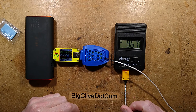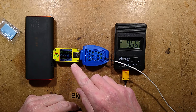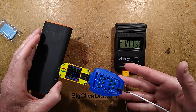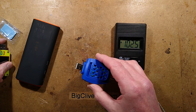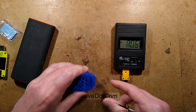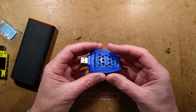That's stabilized. It's just short of 100 degrees Celsius, which is around about 200 degrees Fahrenheit. The current has stabilized at around 700 milliamps, and that's with it hanging over the edge of the table. Now it's time to take it to bits. Incidentally, there is visible vapour coming off it, so these little tabs did have stuff in them. Excellent — I wouldn't necessarily trust it if I was going to be eaten alive in a hotel room by bugs, but you could take your own cartridges, your own little tabs.